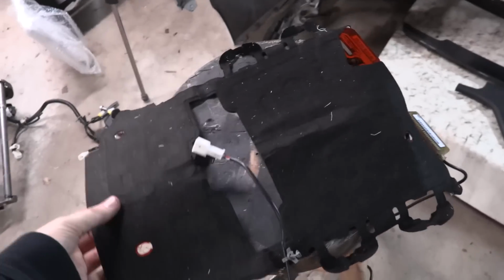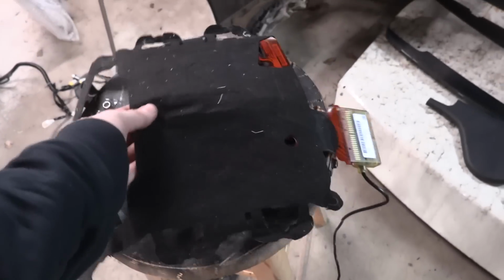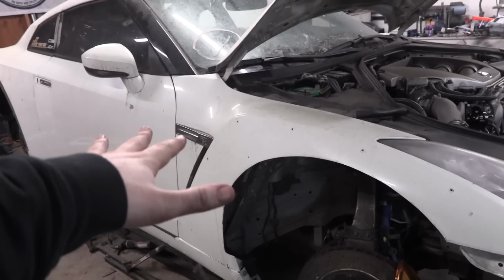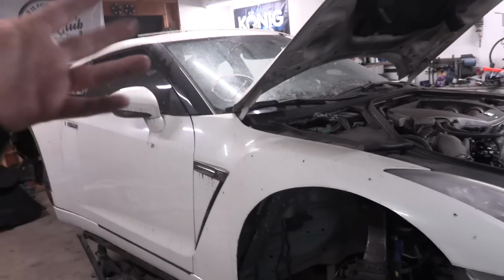I'm just going to simply place this underneath. It needs to be plugged in for the airbag system to work, period. So we're definitely gonna plug it in. It's got a really, really long cable, and I'm just gonna place it under the seat. And then if, say, Chelsea and I are going for a road trip, we'll just have her pull it out from underneath the seat, set it on the cushion of her seat, and then when she sits down, the passenger airbag system will be armed and activated.